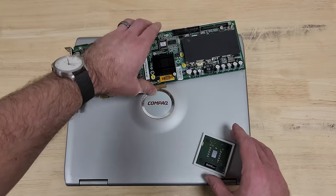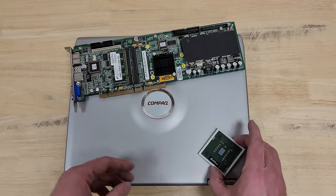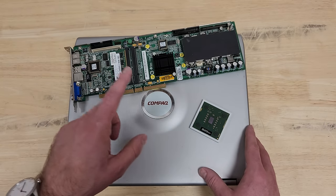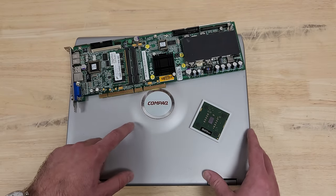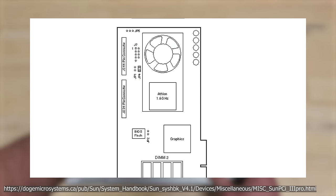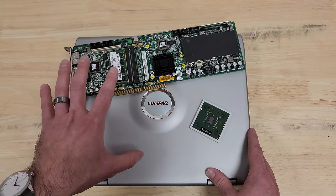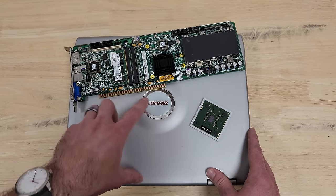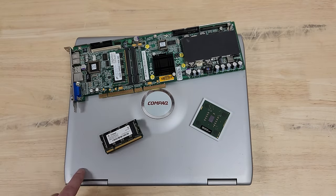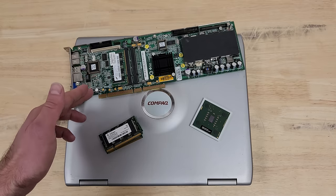So the game plan here is we're going to pop open this Compaq. Hopefully it's got an identical processor to the Sun PCI. Get that in there, and if that works, we'll take this slightly slower one and get that in the Compaq and revive it as well. One possibility is that the Compaq CPU is also bad. But as far as I can tell, the boards are identical — there's no reason it wouldn't accept the slower processor. And if none of that works, it could be that this SODIMM stick is bad, so I've got a handful more to swap in.